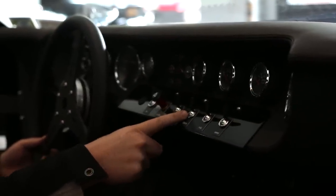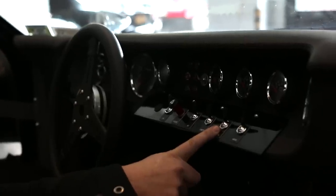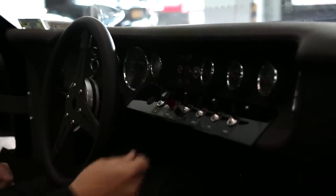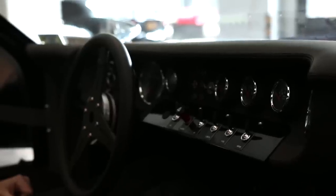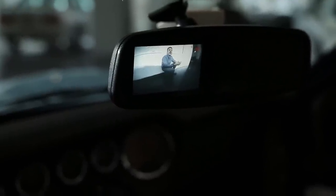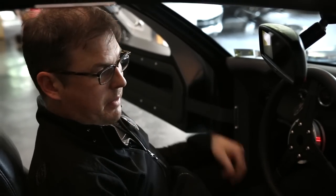AC works and it's actually really cold, but there's no regulation of temperature. You'll put on AC and end up toggling back and forth between AC and vent just to manage the temperature. Lights: up is off, middle is parking, down is headlights. There's high beams and blinkers on the stalk. Fuel: you have two separate fuel tanks, each with their own pump. Up is off, middle is the driver's side tank and pump, and down is the passenger side tank and pump. Without that on, you have no fuel — so always be in the middle or down position when running the car. Wipers: just different wiper speeds — probably something you'll never use because this is not something you want to be driving in the rain. There's a windshield washer and the horn button is up there. Rear view mirror is pretty pointless — you're just looking at the velocity stacks and the motor. When the ignition's on, push this button and a rear view camera display will come up. It's actually pretty useful going down the highway because the mirrors are limited and visibility out the back is non-existent.